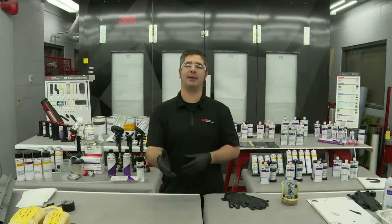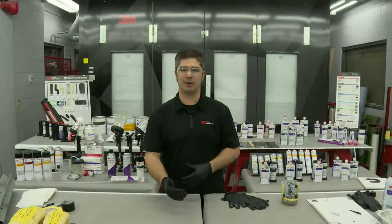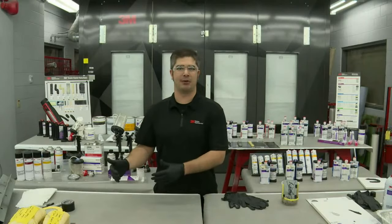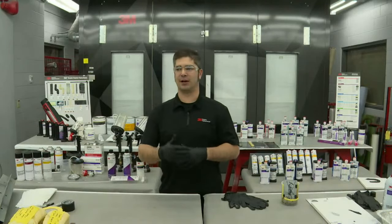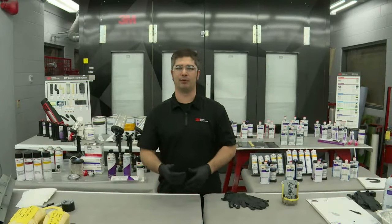That's really an alarming number to me personally, because this is a critical step. The most common application that I see missed, and that I've had several complaints on, has been the Chevy box side. If you get to step 9 or 12, depending on which repair you're doing, it actually calls out an inner panel rust proofing material to be used. In that case, Cavity Wax Plus, right? It needs to be put in there, because this is how we're going to replicate that original E-coat look and appearance from the factory.